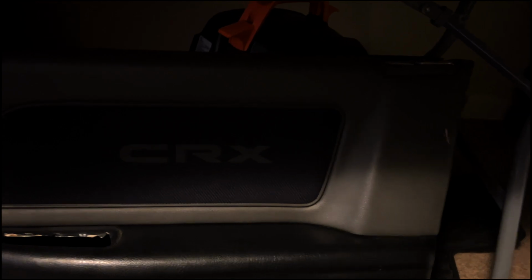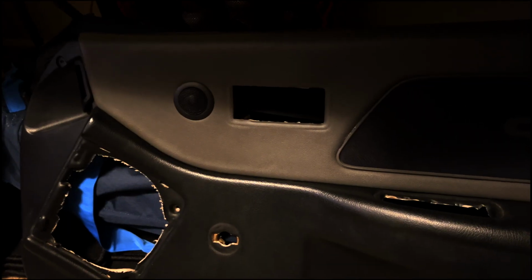Then the other thing was this thing had some damage. Well, it wasn't really damage, but on the back side here, I don't know if you can see, there's these little metal feet. They're like a little claw thing. And I just took some channel locks and pressed all of them together really hard. And then along the edge of this seam here, I put some glue, some E6000, I think it's called, one of my favorite glues, to make sure that it doesn't come off again. So kind of fix that up a little bit. I'm just going to put it together for now and enjoy it the way it is for a little while longer and think about the flocking and my flocking future.